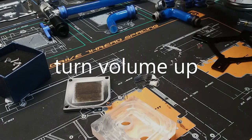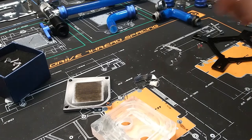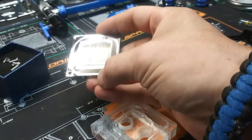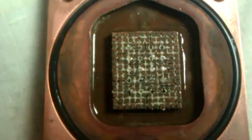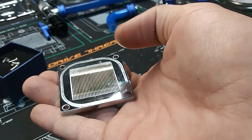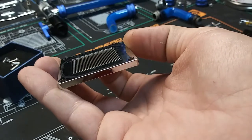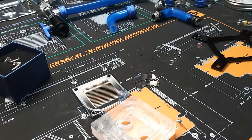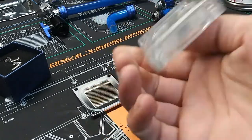What's going on guys, welcome back. I need to rebuild this water block here and get it prepared for the system. You have a couple of things here — this is your distribution plate or back plate, that's where the actual CPU touches. These are the micro channels. I always talk about how your blocks and radiators and stuff will get clogged, and that's what kills the performance. You don't want those little channels to get all clogged up — that's a very bad thing. As you can see, this one's brand new but I need to assemble it. I took it apart a while back for a reason I don't quite remember.